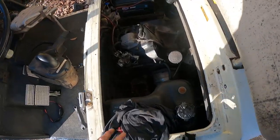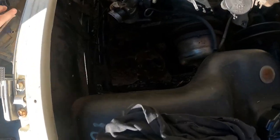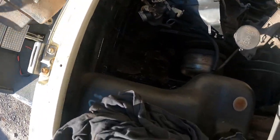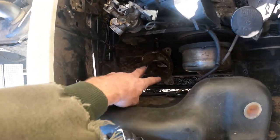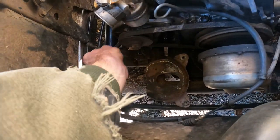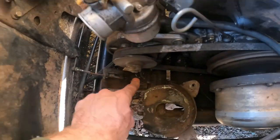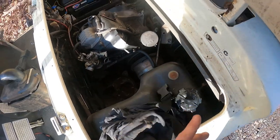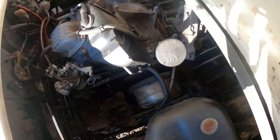Okay, well, I ran out of daylight last night as I was taking this thing apart. So one little tip, while you're taking this air cleaner out, it has one of these little bungs on the bottom that slide onto here. So it's kind of confusing figuring out how to get this off, and finally it slid and popped out of there. You also have to take this little tensioner off here, which keeps the motor from moving too much. And there's a bolt hidden down in here. So there's one here, one in the front, another over there, and 2 in the back, I think. Could be looking at 2 more right there. I don't know. Let's see.